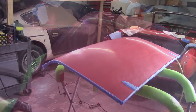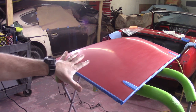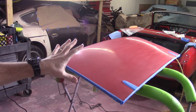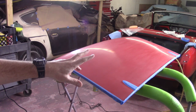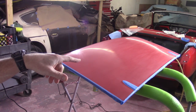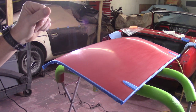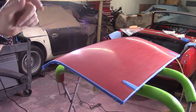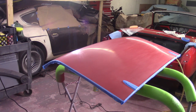One more thing - one of the guys on the SPI forum said that once he's done with his 3000, he puts the buffer on it and within a couple minutes it's shiny. I don't think that's going to happen. Also he uses a rotary instead of a DA. This is a dual action buffer. The reason I went with the DA buffer is because it's more forgiving and it's harder to wreck stuff - a rotary gives no relief and it's really easy especially with wool, which is aggressive. I'm afraid that's going to burn through.